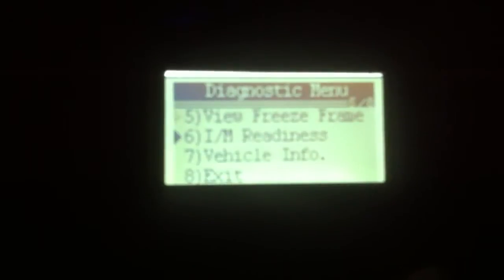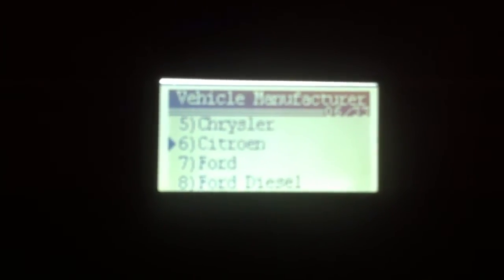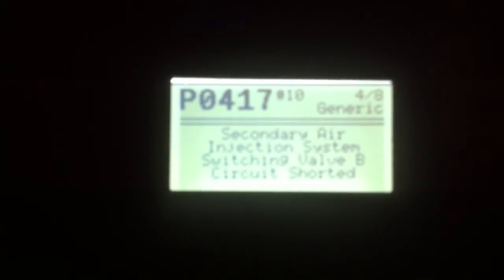Let's see what kind of codes we've got going on. I remember there were seven — I didn't know there were eight. Speed sensor, of course. Evap — not plugged in, not using it. Secondary air injection — not using that. O2 sensor — not hooked up, not hooked up, not hooked up. So it's everything I know.